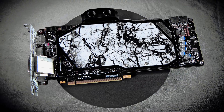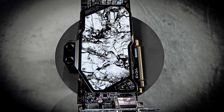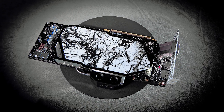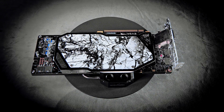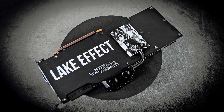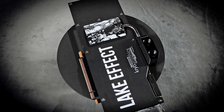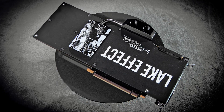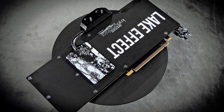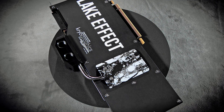Here's the GPU we're going to be using in this build — it's an EVGA 980 card. We also married it here with the Aqua Computer water block and got the black marble hydro dip done to it as well. I just think it looks phenomenal. Flipping it over, this is the back of the graphics card — we have the Aqua Computer active back plate, which has a heat pipe that goes from the back plate, cools the VRMs, and goes right into the water loop. We have the name of the build engraved into this back plate, and also did the PCI bracket and that little cover with the hydro dip, just to give it a nice effect when you're looking through the window.